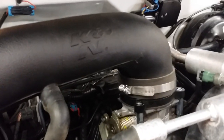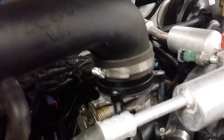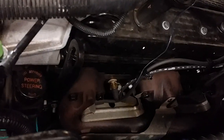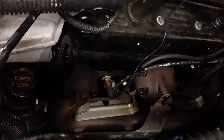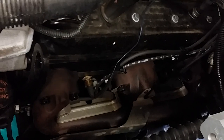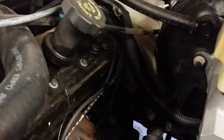It's a simple unbolt — one simple screwdriver right there and that thing pops off. Then there's another bolt inside the fender well, so we pop that off and disconnect it. Then we're going to start with the driver's side. You can see the standard manifolds — nice and rusted, but cast iron and reliable. They've been good for 17 years. We're going to take off the spark plugs, and you can see the wire looms bolted to the head and the EGR in the back.